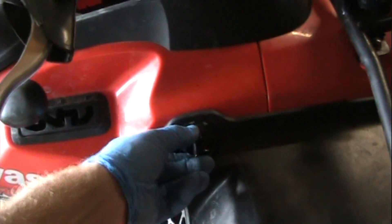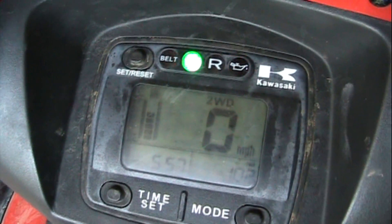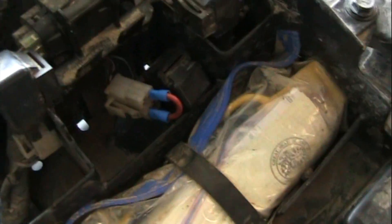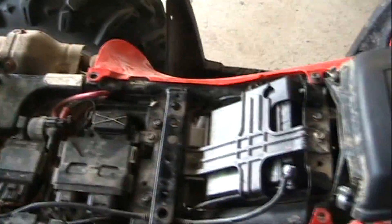Take and turn the ignition on — fuel pump noise, good old fuel injection light coming on, I wonder why. Looking a little more like stock and normal. There's a fuel pump that's on — giddy up. For those who didn't see the other video, that whine in the fuel pump is the fuel pressure regulator letting by more than 43 PSI due to the fact that I modified it with an automotive fuel pump. Check out the other videos if you have any questions about that.